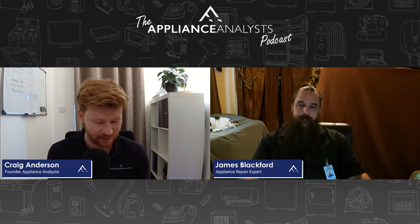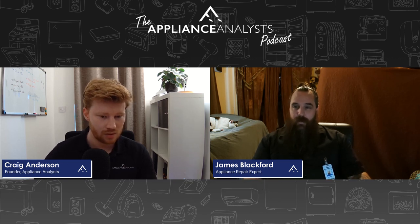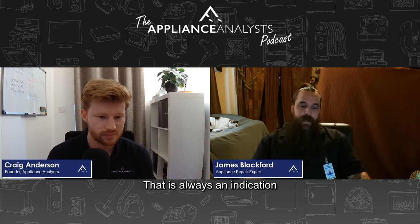Makes sense. One sound that I do hear quite often in the field is that the dishwasher sounds like it's running loud. Or when it's washing, it's a loud buzzing or an electrical motor type sound. That is always an indication that your wash motor is going bad.